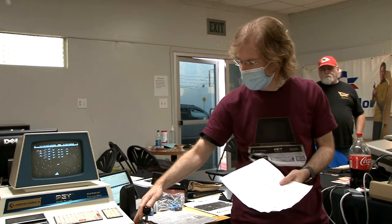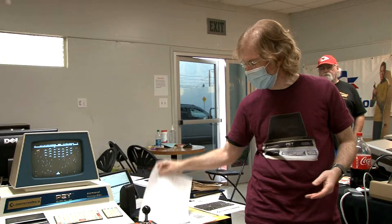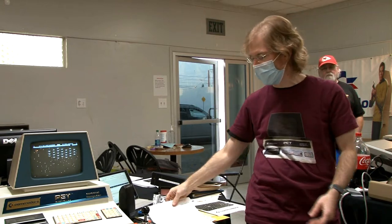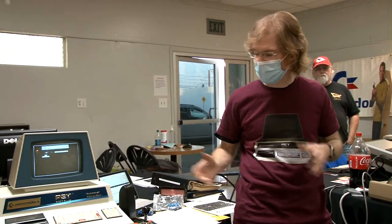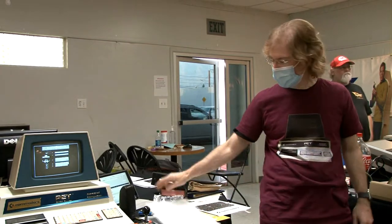Jim has converted a few games to use his joystick. They were already joystick capable but had scrambled direction mapping. In Basic, some programs had a joystick string at the beginning with numbers corresponding to left, right, up, and down — he figured out the correct mapping for his hardware and changed that string to fix the joystick for several games. He's trying to find more joystick-plus-sound games.